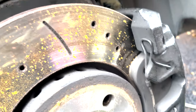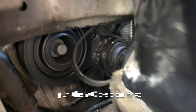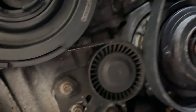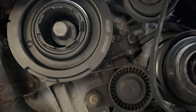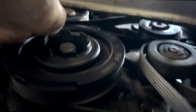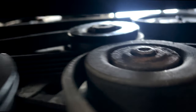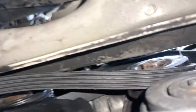So that's more than enough tension on that - I essentially wedged a bar underneath and pushed it up, giving it enough tension. You may notice my belts aren't looking too great. I know one isn't great but the other one's fine, so I'll probably replace that one ASAP. For now, to get it running I think we'll be alright. That's all going around wherever it's supposed to go. There's a lack of tension here - I need to do the tensioner. The aircon belt's fine. You need to get a 22mm in there on that little automatic tensioner.